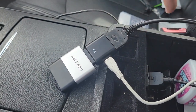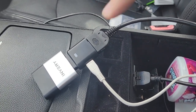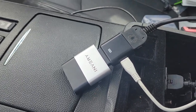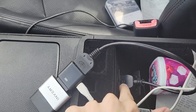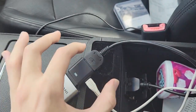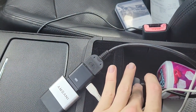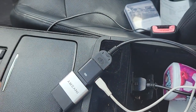One of the things I'm going to link below is an iPod-to-Infiniti adapter, and you will need three things for this, and that's it. I found that these things worked the best and were the best priced. The Infiniti iPod port that's right here — you can find it anywhere, most of them work pretty fine. I had to order two of them because the first one didn't arrive, but I ended up getting one that was like $20. Keep in mind, it doesn't have power in it, so power does not come from this and go to your iPod in the 2008 G35 models, which is what I have — I have a 2008.